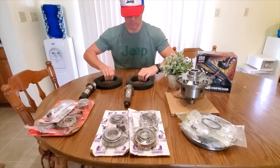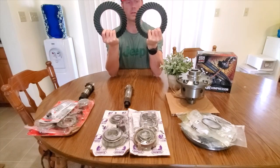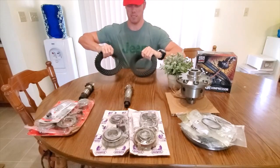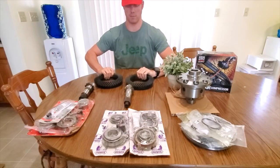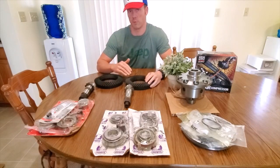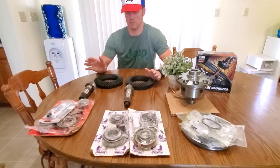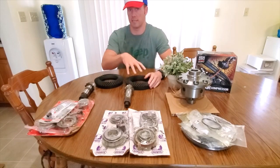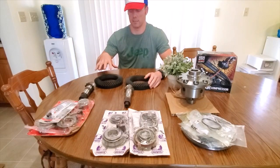So when you look at these, one's going clockwise and one's going counterclockwise. Why is that? Because the front axle is high pinion, and the high pinion allows the reverse gear cut. That's why when you buy gears, you had to buy the Dana 44 reverse cut. On these axles, they're all Dana 44 — the front's going to be the reverse. If you buy a 210 you're getting the reverse, no matter what. Buy the 220, you're getting the correct gear no matter what.